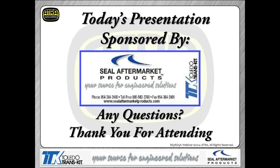This is the mid-2004 and later. The early and the late are the same. And the third design, I don't have a picture of it here, but the only difference I found in the valve body on the third design, as far as the valve lineup, is they only have one neutral to reverse accumulator instead of two. Now, keep in mind that the third design valve body went through many changes in hydraulic circuits, and we're going to talk about that in a little bit.